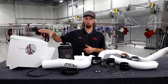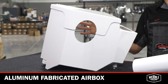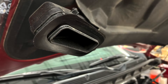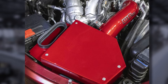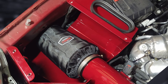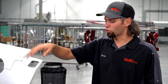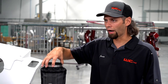We've got our 4-inch High Flow Intake Kit starting with our aluminum fabricated air box. This air box is open to the fender well. It uses the ram air induction on the front side through the grill and also incorporates ram air induction on the hood just like OEM using our double bulb seal. The lid is removable with four screws for servicing the air filter. Out of the air box we've got our rubber trim seal going around the edge to seal the 4-inch mandrel bent aluminum intake pipe. This aluminum intake pipe on the end holds our High Flow 4-inch dry air filter.